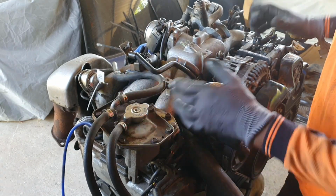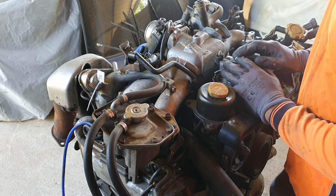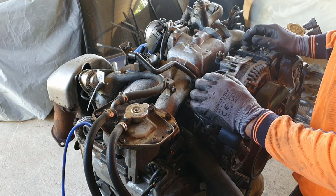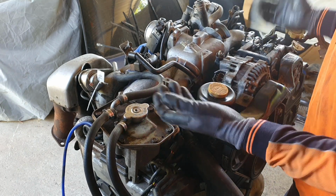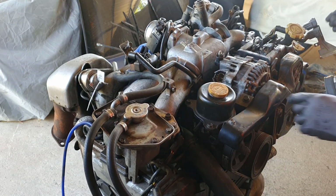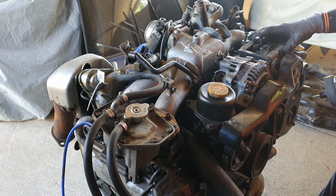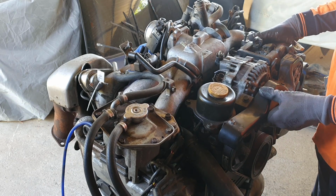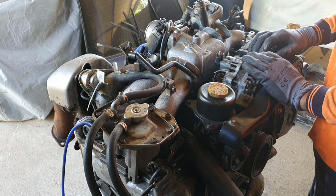Engine block and the basic setups are still the EJ20, the Boxer engine. These engines are not a bad little donk. They run quite reliably. They've got hydraulic lifters in them rather than solid lifters. However, for what we want it for, this thing will run perfectly. Now, surprising for a rally car, for some odd reason, the air conditioner compressor was still on. I don't know if the air conditioning was actually working in the old rally car that was in there. So we'll get rid of that today, tidy this all up and neaten it up.